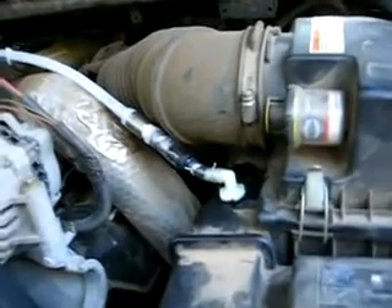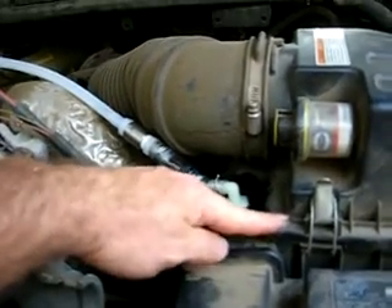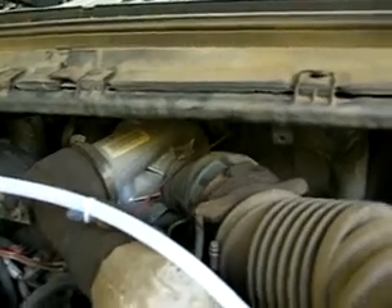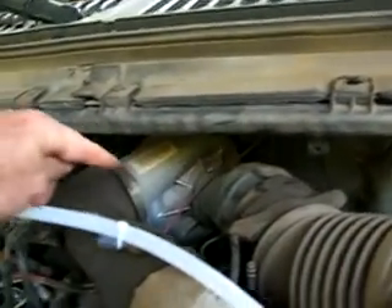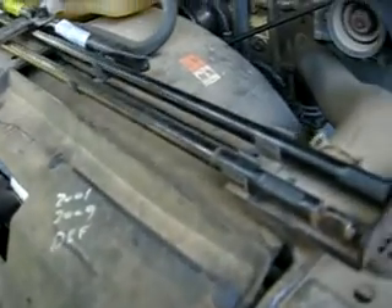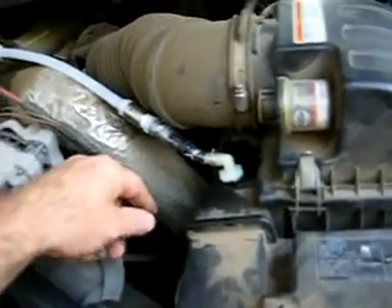You can see the hose coming up. I had a hard time deciding where to have the HHO go in. This is actually going in before the air filter. I've read a lot of conflicting opinions on that. Most people say you should put it as close as possible to the intake, but this is a turbocharged engine, and right down here is about as close as I could get. It's got an intercooler — like a big radiator in front of the other radiator. These pipes hold a lot of volume, especially since it's all compressed, so I figured it wouldn't make much difference to have this extra volume of gas.